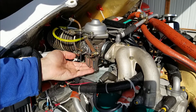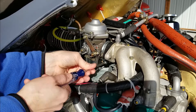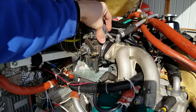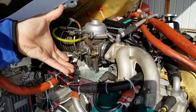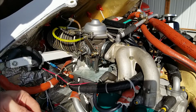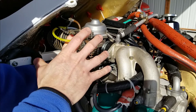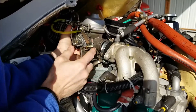To remove the bowl, it's sometimes a little difficult based on your engine and aircraft type, depending on how much space you have with the drip trays. Take a screwdriver and loosen up the socket quite a bit because there's an undercut that needs to pop out — you want that good and loose. Disconnect your vibration dampening spring, then you can grab the carb by the top, the air intake, the bowl, or any solid structural part, but be careful not to manhandle it. These linkages are somewhat delicate and can be bent and tweaked, so to preserve your carburetor settings and synchronization, just don't start reefing on things. Grab it by the bowl, the top, or the air intake, and understand your fuel line is still connected. There's some resistance, but we want to pop the carb out of the socket — just twist and rock and pull, and it pops up and out.